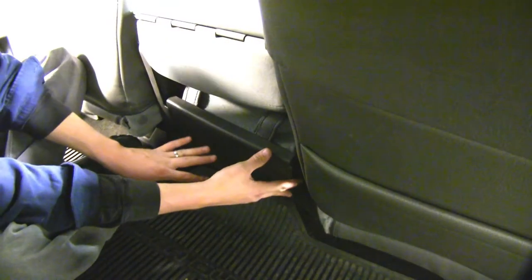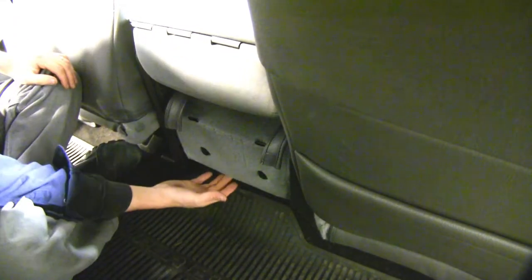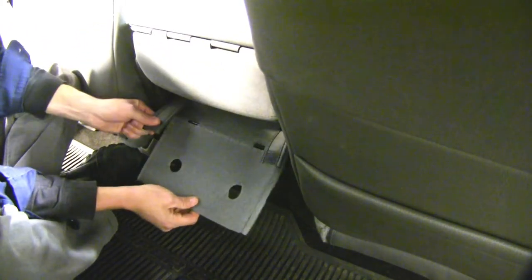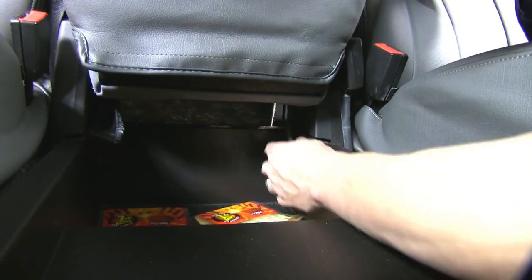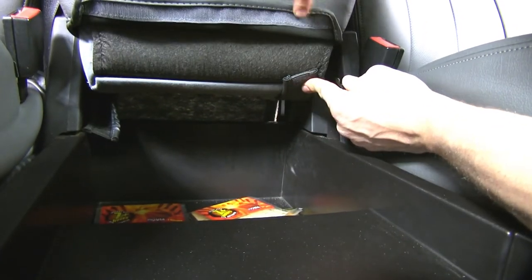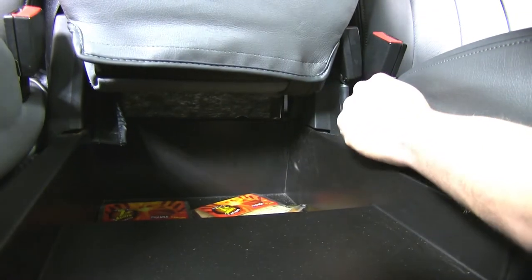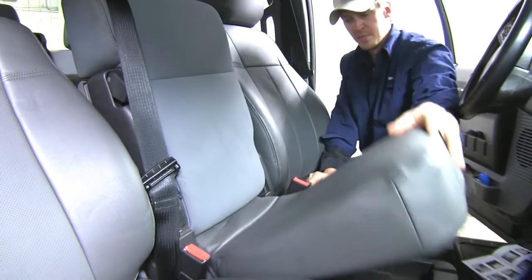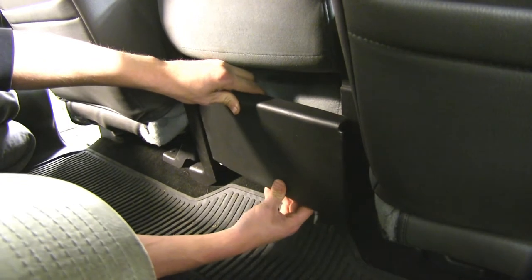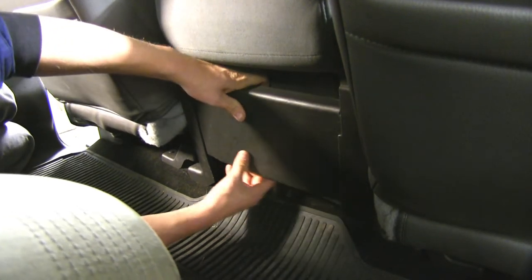Come to the back and remove this tab by lifting up and prying it off — you'll see the two tabs underneath. Get underneath and pull out the bottom portion of the tab that's going to connect to the hook and loop. With the back panel removed, push the tabs through to the front side and connect them to the hook and loop. Pull it nice and tight and pull that down over top for both sides. With the cushion connected, go ahead and replace the panel — put one side in first, then the other, and push it down back in place.